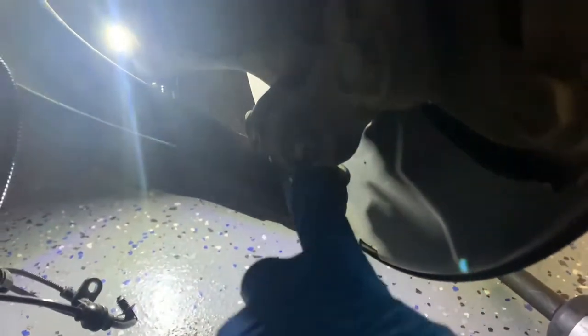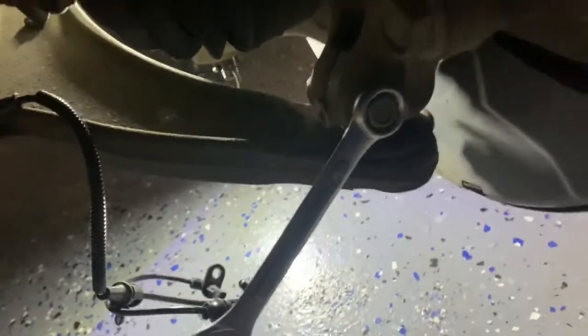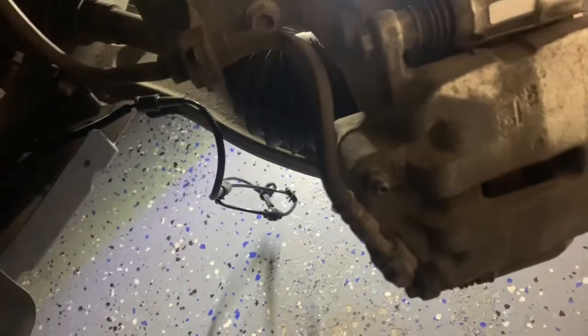The other thing we're going to do is remove this nut — it's a 15 millimeter right there. We're going to hold it from this side and open it with my impact wrench from the other side. So we're going to move that before we try to take the lower control arm off. It's a 15 millimeter — hopefully now we can go into that area with a little screwdriver, pound it in, and hit the control arm to remove the axle.